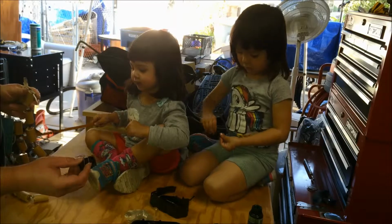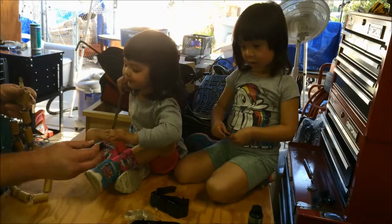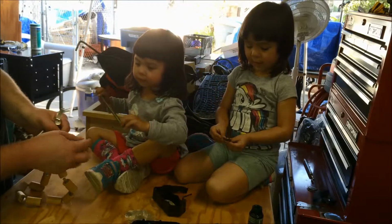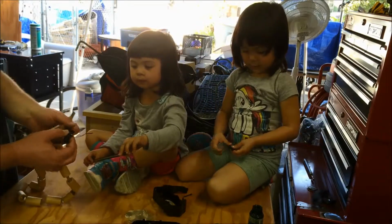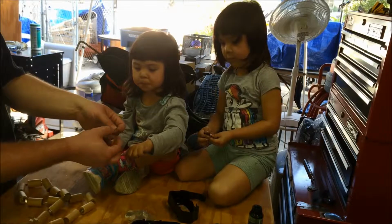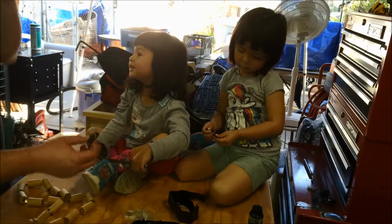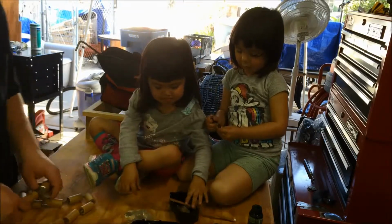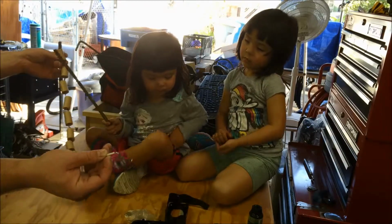See, one of these comes in from the charger, and it goes through the thermal cutout, and then it comes back, and this one is the one that's connected to the battery. So if the batteries get too hot, it makes these disconnect, and then the battery won't catch fire. So that's what's in a battery pack for your drill.